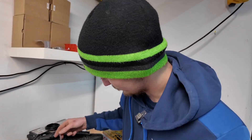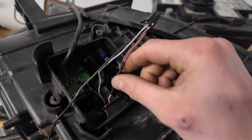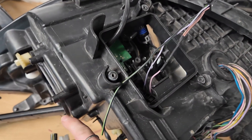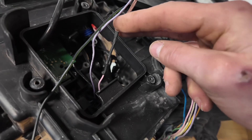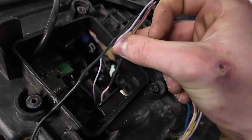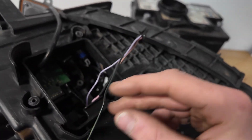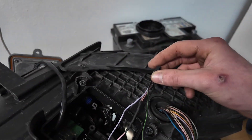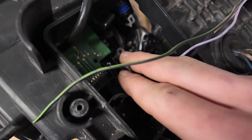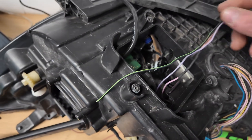Just a quick update of what is going on. We've pulled the wiring through because it's in there, and we've pulled it all the way up. We've done the one repair - this was the pink one that was broken down the side here. It was actually broken just before the join, so what I've done is chopped it back to where the two wires meet so I can make a better connection. Instead of it just being crimped, I've soldered them all together and done the repair. What we've had to do is re-pin this one - the one that was broken right at the plug. We've had to solder on a new wire to the pin. And it was broken again - same wire broken twice. So I'm just going to do this repair and then we're going to test it out.